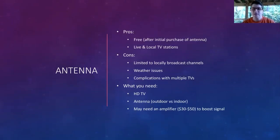You do need an HDTV and an antenna — maybe indoor or outdoor depending on where you live — and you may need an amplifier if you live in an area not close to a city to boost the signal. The reason you need an HDTV is that the newer TVs and stations broadcast in a different format, so you need that HDTV in order to pick up the signal.